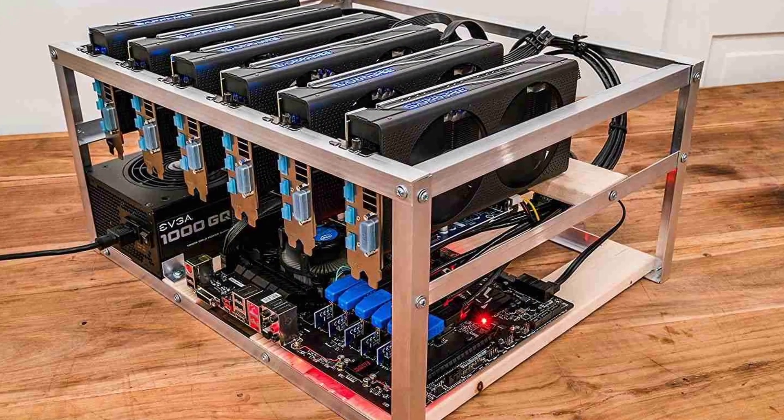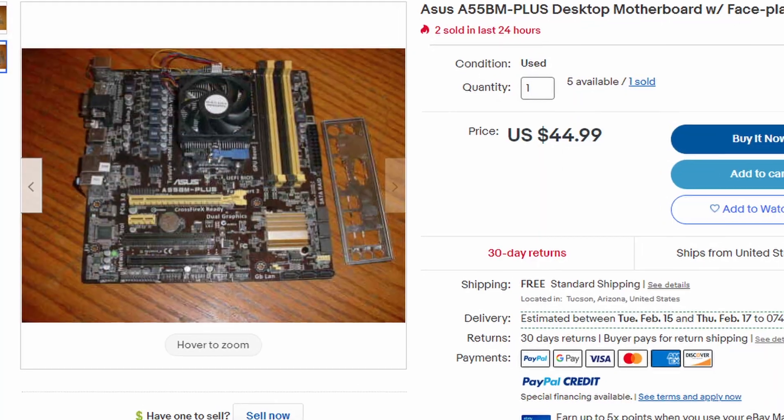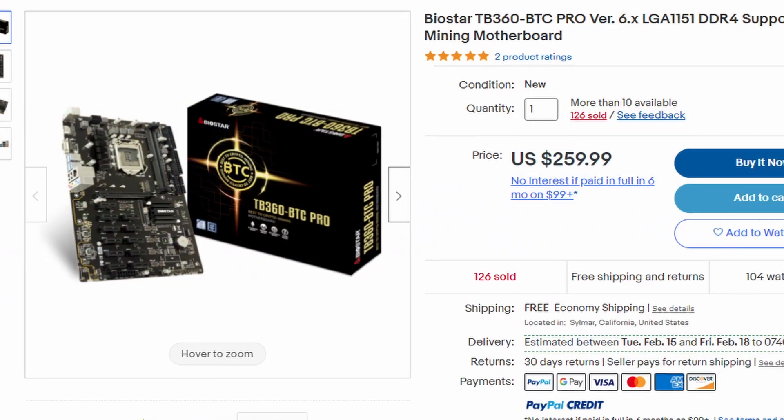If you do some simple math: if you have two PCIe slots, you plug one in with this device, you have one free slot on the motherboard, and four USBs to hook up risers to — totaling five GPUs on your motherboard. This is huge. You could basically take an old motherboard and make a full mining rig out of it. Five GPUs! This is super economical — you can find a two-slot motherboard pretty cheap and skip the fancy mining motherboard that costs hundreds of dollars. Good for the environment, good for your wallet.